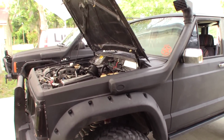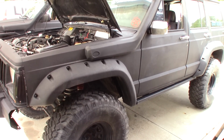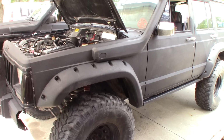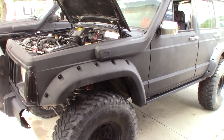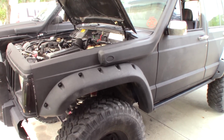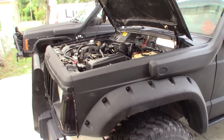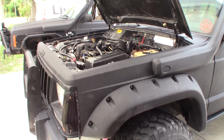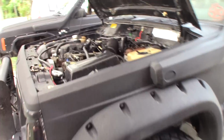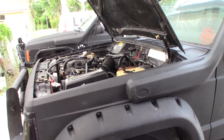Next video we make, we'll be working on this Jeep and getting it all straight and ready for the camping trip. Try one more time to fix the air conditioner. I hate to fix it because it don't ever run hot or anything, this thing don't even get above 180. But I got a cut out thermostat in it too. The thermostat's a 180 that's cut. I cut the center of it out because I didn't want her to have any running hot issues, and it don't run hot at all. And I got her fan wired in to where it's on with the key on with a relay.